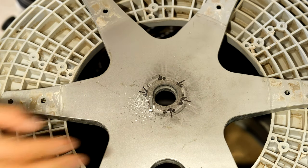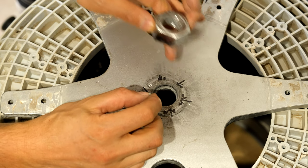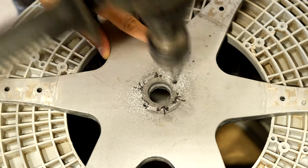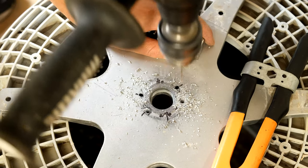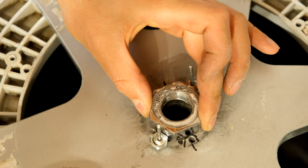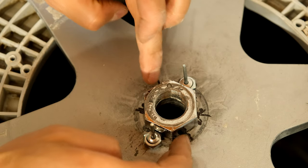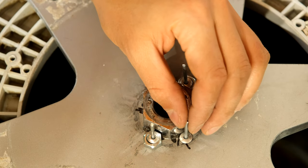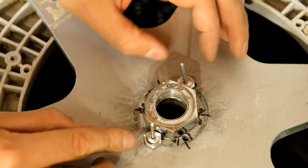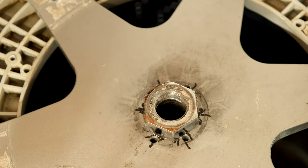Here we go — I want the head to stand out a bit. I'm going to put another hole on the other side there. As you can see, with these rivets and nuts in place, if the plate tries to turn it can only move a tiny bit — which is better than the way it was. I want to lock it in place so I can put one or two more rivets here. Now why I'm using rivets: if you have to open this again, you can just drill out the heads of the rivets and then remove the nut if you need to service this part again.